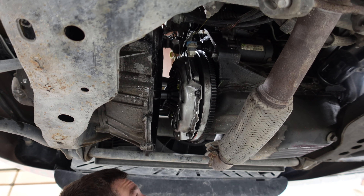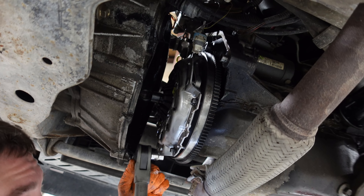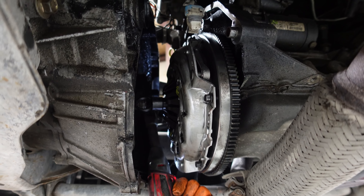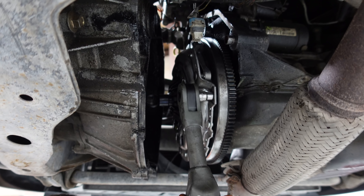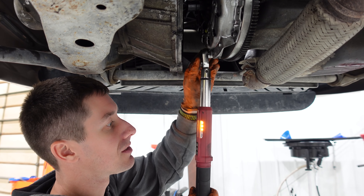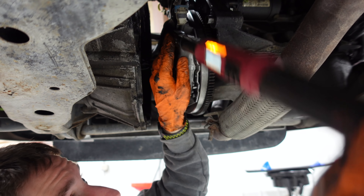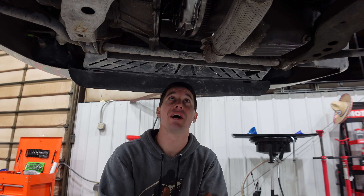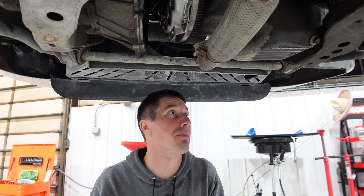We have enough of these things started — I've got five of the bolts in. I'm going to go ahead and start tightening this thing down so I can rotate the flywheel and do the other one easily. We'll have to make a couple passes around this thing to make sure it's all evenly tightened down. There's 19 foot pounds, and I'll try to cross torque them at the same time. So we've got the flywheel back on, pressure plate on, clutch — everything's assembled and lined up. Now we are ready to put the transmission back in its place.